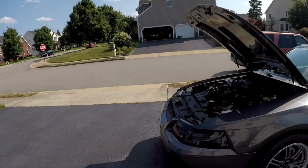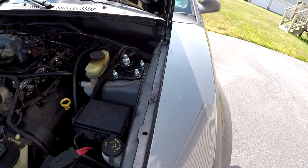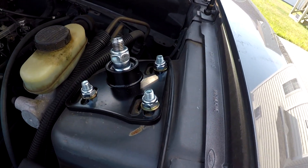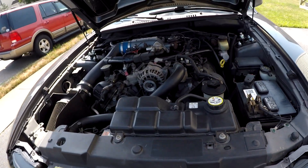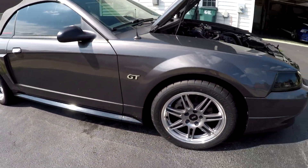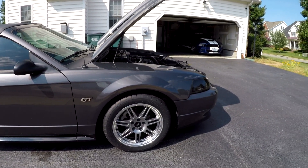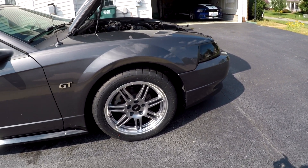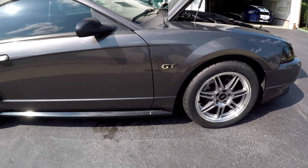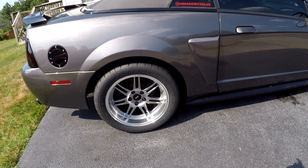That's a quick little show of the car — now let me tell you what I did to her. Right here we have the SVE caster camber plates, so they are in there to give her a little more of a straighter ride. It is raised up from what it used to be. She's on H&R Super Sports, and then she has 275/40/17s in the front and on the rear she has 315/35/17 deep dish.